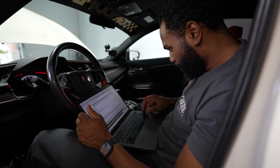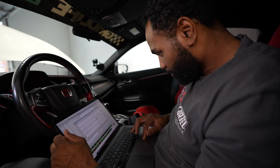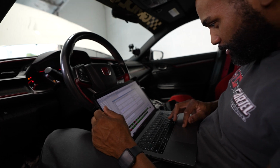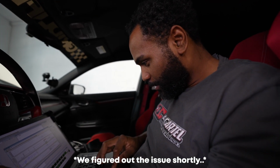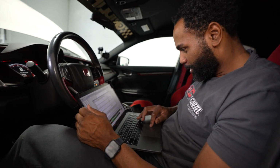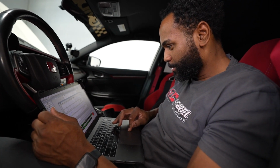Well, let me look at the wastegate position though. By the way, everybody, this is our tuner Daniel here, giving us some knowledge. He's giving us the sauce today, but we're having some weird issues with the new turbo currently. It's like the wastegate is shut from around 3,700 RPM on down. Really? Then it opens up from around 4K. So this turbo must be a decent size then.